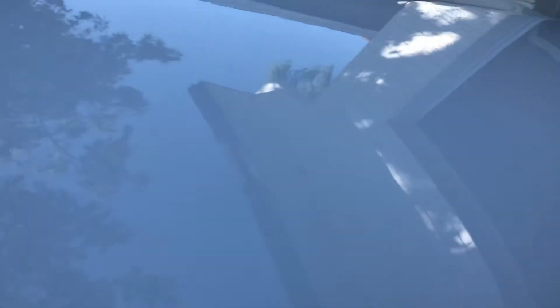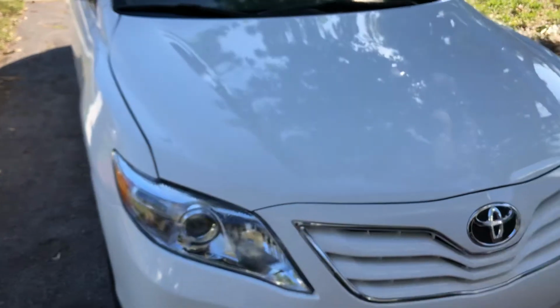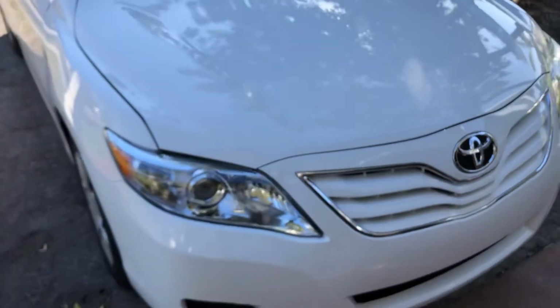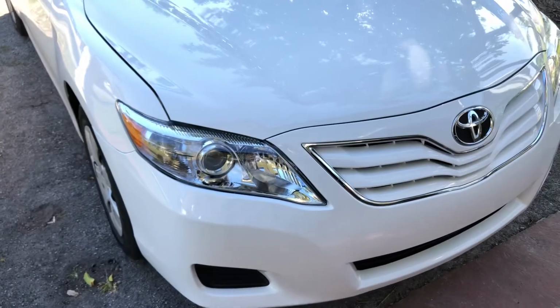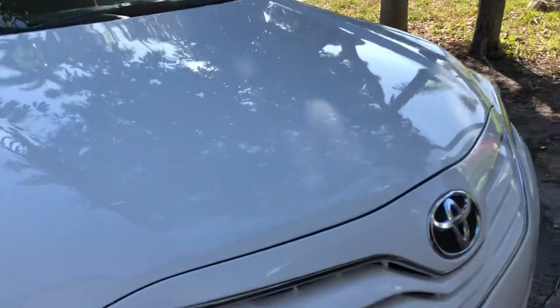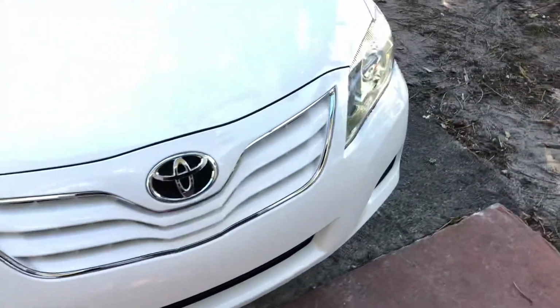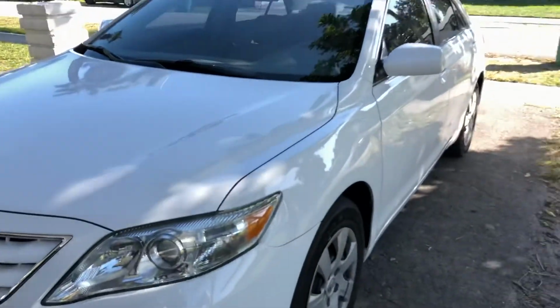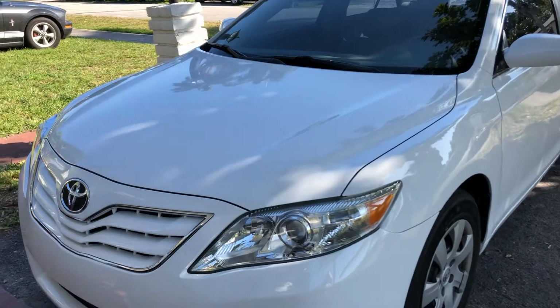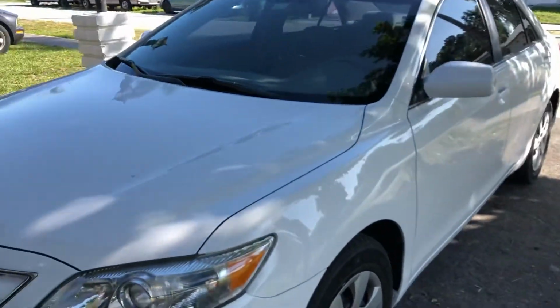But already you're talking about the differences between the $2,000 paint job and the $3,000 paint job, because any paint job that consumes a whole gallon of clear coat, which is actually a gallon and a quarter, because you have a gallon of clear, and then you have a quart of activator, being that the ratio is 4-to-1, you got 5 quarts. And to apply all 5 quarts of material is a lot of work, including all the material that you're applying when you shoot the base, plus the work associated with it.